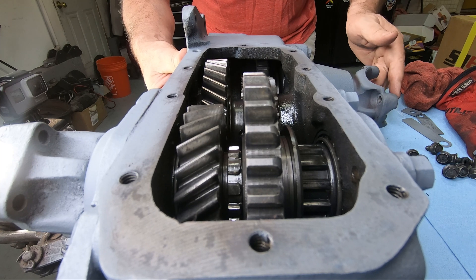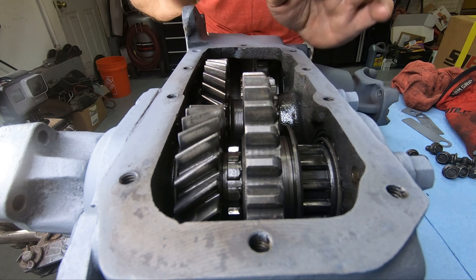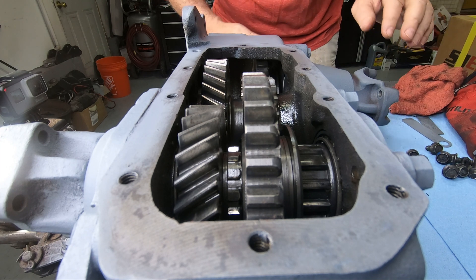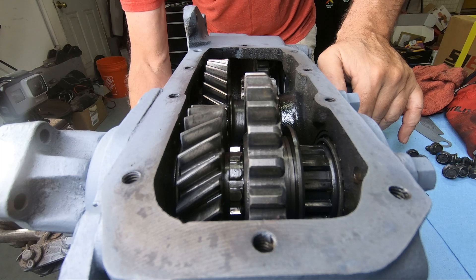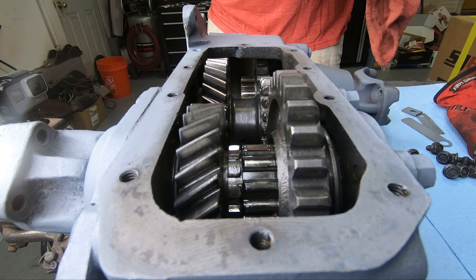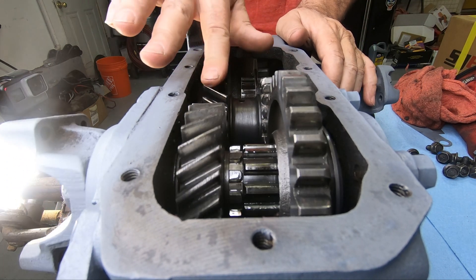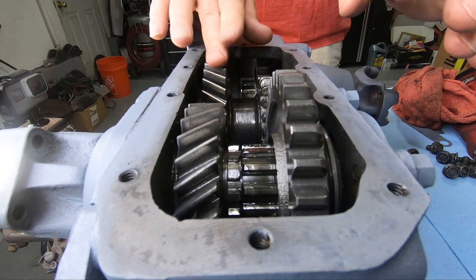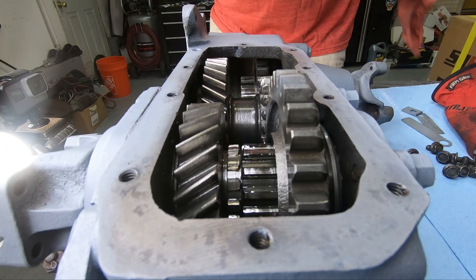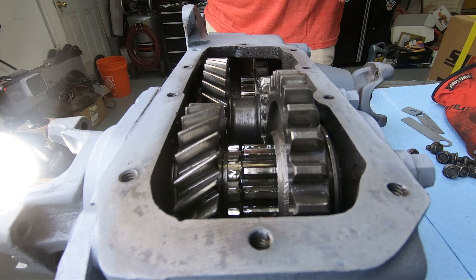At this point I'm still not engaged with the front drive shaft, so I'm in a kind of two-low with the front not engaged. One more click slides the final gear into place — the output ring of the transmission turns this, which turns the next gear, which engages the front yoke. Now my front drive shaft is moving, my rear drive shaft is moving — I'm in four-low.